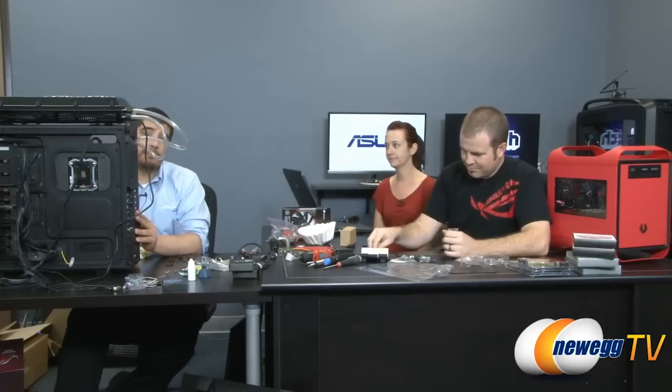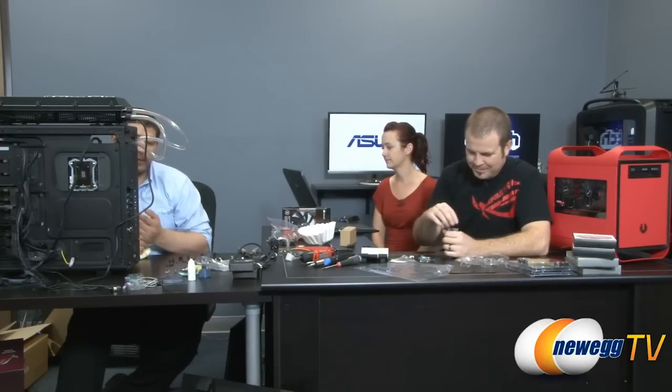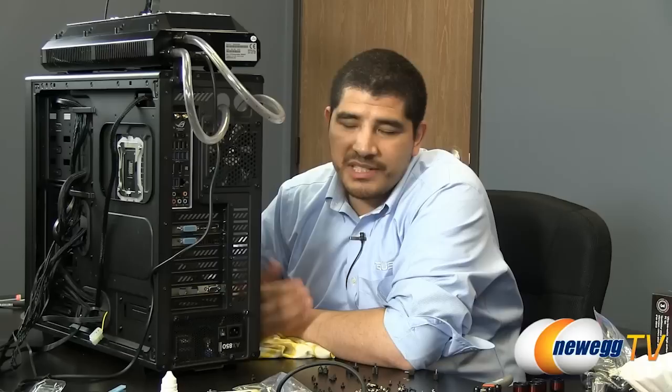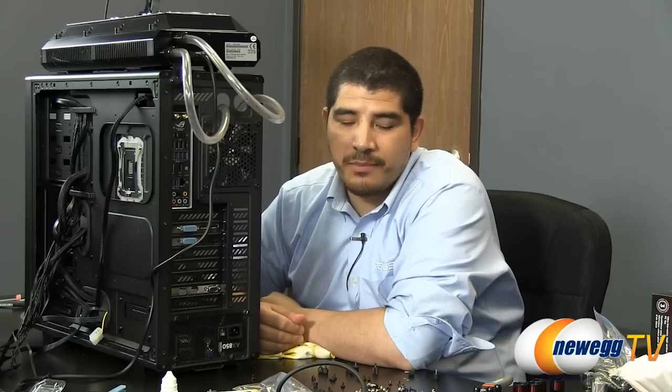Yeah, I think GPU Boost 2.0 is actually great. It's been a really big benefit for us, since our non-reference based designs provide a much cooler level of operation than the reference-based designs, so our cards are able to boost significantly to much higher frequencies and consistently operate at that. So if you had a target frequency of, let's say, the card running at 980, we could be boosting all the way up to 1100 megahertz consistently, offering a much better range of performance. That follows the adage of what we're trying to do with DC2 cards. It's about being cool and quiet and giving you superior performance.